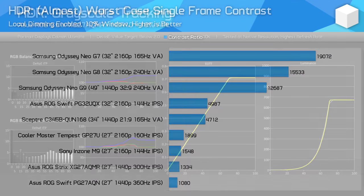Final section is the Hub Essentials checklist. Across the design and colour sections, ASUS does well, only receiving a penalty due to using HDMI 2.0 instead of HDMI 2.1. For motion performance, advertising a 1ms response time does exaggerate the display's typical performance, however the best transitions tested were in the 1ms range. I also don't think the backlight strobing quality is sufficient, however I was impressed with the single overdrive mode experience and low input lag. The other penalties ASUS receive are in the HDR section — while edge-lit dimming normally receives a semi-HDR ranking, the actual experience here is awful, so that's worthy of a penalty. The contrast ratio is also far too low thanks to a pathetic zone count. However, I didn't spot any issues or defects, we're getting a normal sub-pixel array, and flickering is not a problem while gaming.